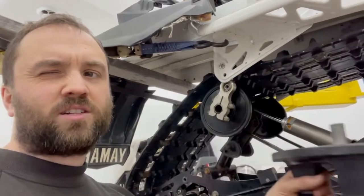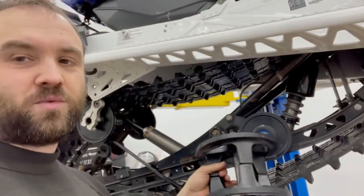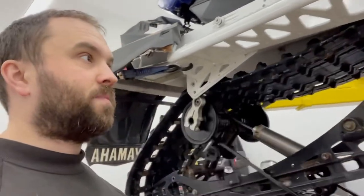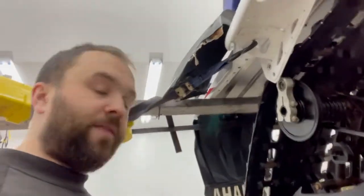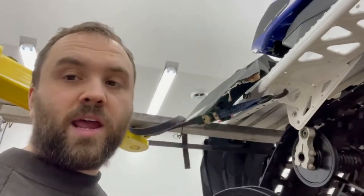Welcome to this machine - I think it has five or six thousand kilometers on it. The bottom bearings were pretty dry except the two side ones, which I think were probably changed at one time because they didn't have a Chinese bearing. They use Chinese bearings in this whole sled - the main shaft bearing is a pure China bearing. Nothing wrong with China, just sometimes the quality is crap. Bearings on sleds go dry - anybody who rides a sled knows that.